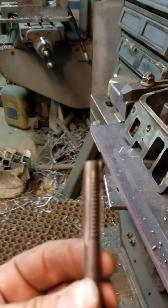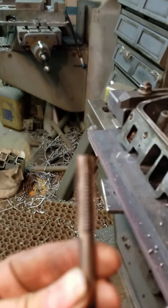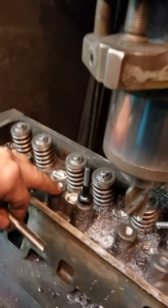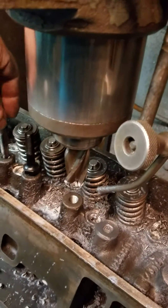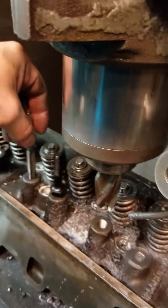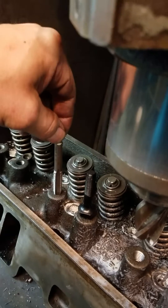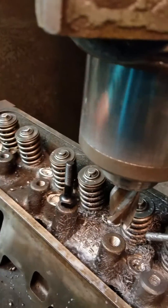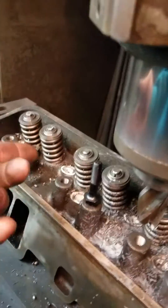What I had, I just tapped them by hand. I picked up this self-centering tap — if you look at the very tip of it, the first half inch has no threads on it. So your original holes, as they were set up for the push-in studs, this just sets right down in there and pre-squares the tap so that you don't need to worry about being off. Even with these already being tapped, it's pretty tight. So I just used that to chase the first half inch of the threads and then changed over to a regular tap to finish it out, and that worked really well for tapping them.